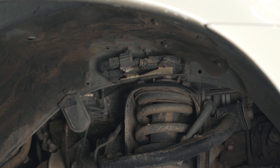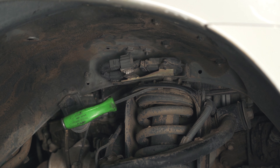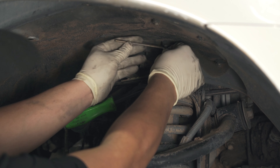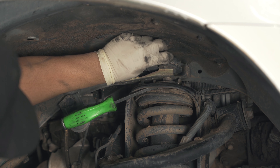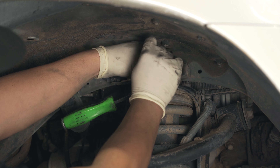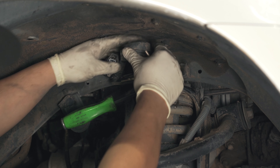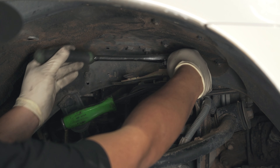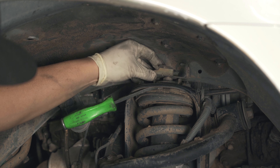With all the suspension kind of loose, we can push down on the suspension. You can stick either a screwdriver or a pry bar just to get a little extra room sideways so that you can remove the motor off the shock itself. You also want to get the one in the back too. Then lift the motor out with the harness. After the motor is removed, take a 17mm socket wrench, loosen up the top nut, and remove the whole unit together.